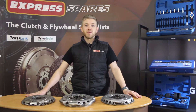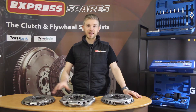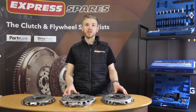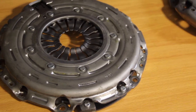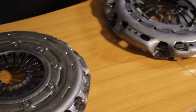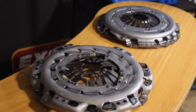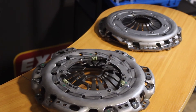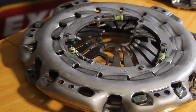Hi, I'm Dara from Express Spares and welcome to another one of our drivetrain videos. Today we're looking at self-adjusting clutches and we're helping you identify the three most common types that we come across. There are a lot of advantages of self-adjusting type clutches which include shorter pedal travel, low release loads, and simplified release system layout. This is why many vehicle manufacturers are opting to use them over conventional clutches.